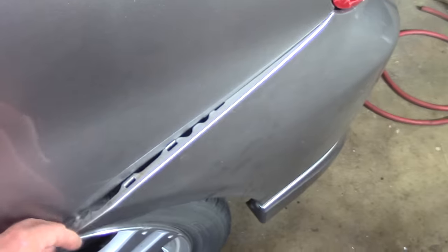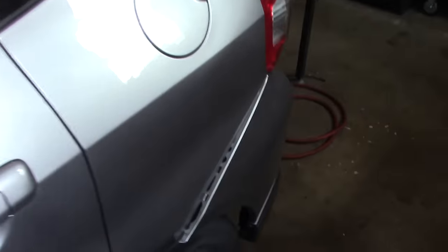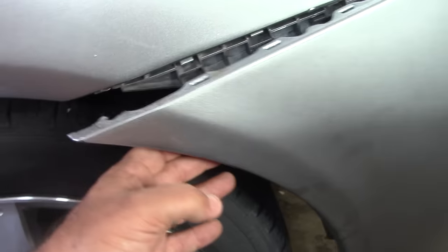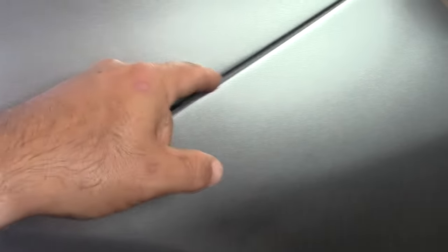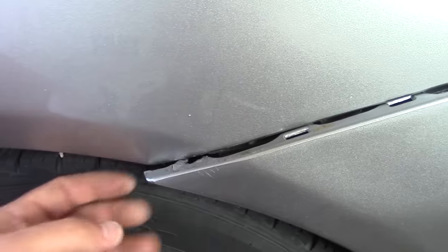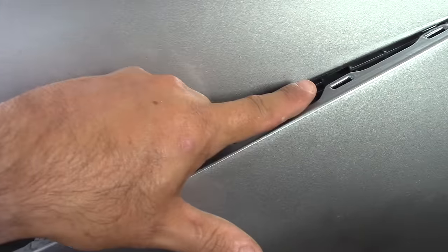Here's what we have going on. This is my '08 Honda Fit and the bumper is loose. What happened was about a year ago I backed into my truck — I had moved the truck to an odd spot so my son could play basketball. The clip is broken off here so there's nothing to hold this on, and with the wind pressure it opens up when I drive. All these are supposed to lock into these clips, but they're not holding because when it went to the body shop they put a little piece of metal in here, and that metal is holding this down and not allowing the clips to actually engage.